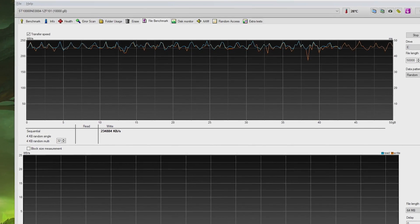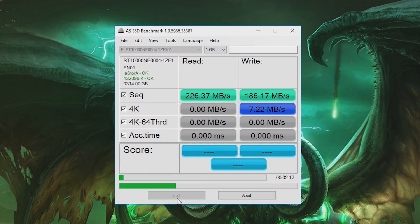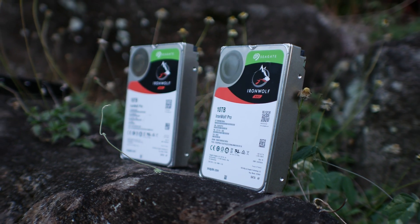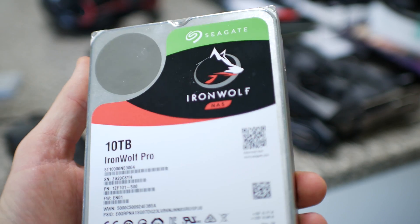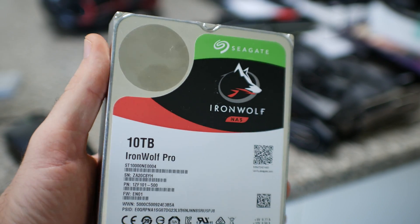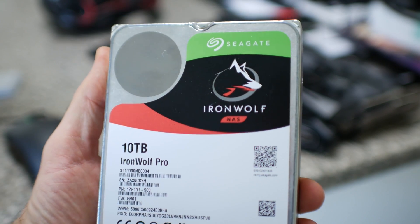The consistency of the read and writes was again very good. An interesting point was that the 4K random read and writes were also quite high for a hard drive, which would indicate that these drives are designed for constant writes. This will not only serve perfectly as a NAS solution but also for security solutions where consistent writes are a must over RAID 1 arrays. You also get rotational vibration sensors on board which help eliminate errors from vibration, and the drives are more shock resistant to vibrations than other hard drives.